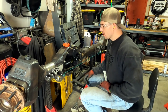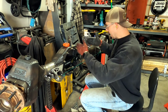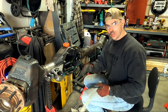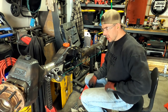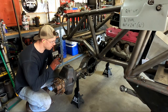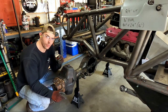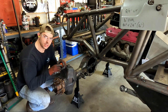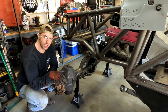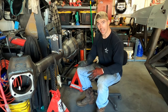I built two link tabs — the outer tabs are roughly 70 degrees, which gives us our link angles back to the chassis. I measured the separation of the upper links: to get our 40-degree minimum, we're looking at roughly 45 degrees, so there's plenty of margin to keep everything centered. The front axle is not going to have any problems. Got the axle set underneath the chassis with the wheelbase measured at 115 inches — a little longer than the anticipated 113, but I did extend the rear out a couple of inches and I think that's going to be fine.